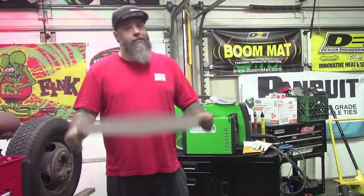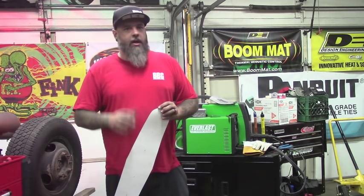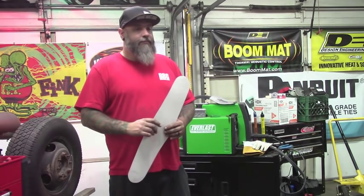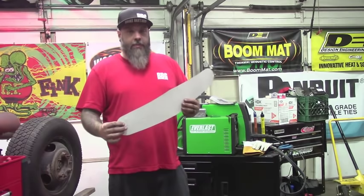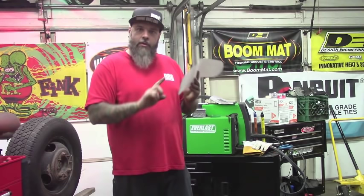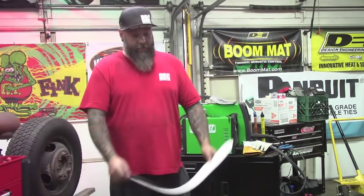To do this the way I'm thinking, I need eighth inch steel — that way it's nice and rigid, kind of bulky looking, sits off the dash, looks great. The problem is coronavirus — none of the places I get steel are open. So I dug around in the shop and all I've got is a bunch of 18 gauge. What I'm thinking I'll do is bead roll the 18 gauge around the edge to strengthen it so it won't flex or wobble. When you look at it from the side it'll look thicker because it's bead rolled over. Anyway, that's the plan — it might end up in the scrap pile like everything else.